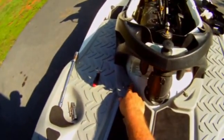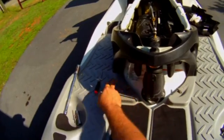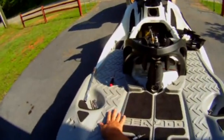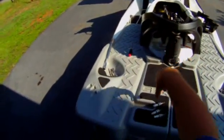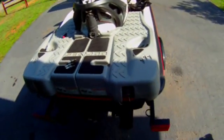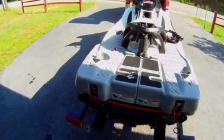Your valves are right here and here — two tanks, two valves. Right now they're in the closed position, and that keeps water from coming into the tanks. If you want to fill the tanks up, you simply open up the valve and the jet pump pushes water up into the tanks until they're full. That is how you add weight to the back. To drain that weight, pull the plugs — and there you have it.